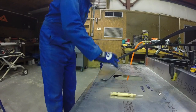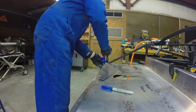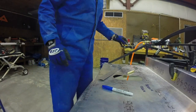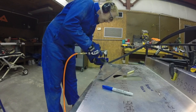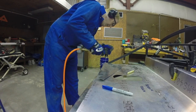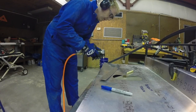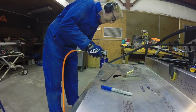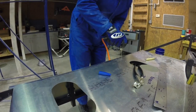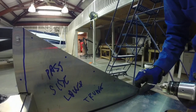I also marked the holes using the tools they give you — or as I'm doing here, I used a punch to make a guide hole. Before removing the panels I left the screws in place where they hold them, then did the holes between the aluminum and the metal of the frame. By the time you put it back together, I'm really happy I followed that advice. You put silicone, put some clamps to hold it in place, and off you go.